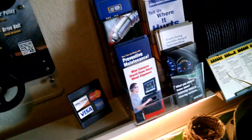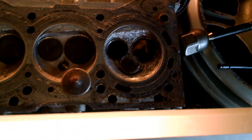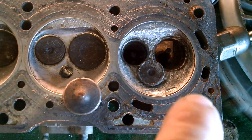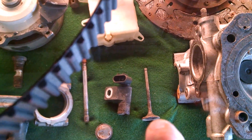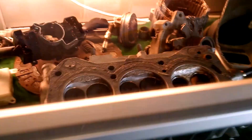What can happen if this does break — here's an example from an old three-cylinder where it actually did break a timing belt a number of years ago. It sits in our display here — we call it our display of shame — where parts have failed just because of maintenance in most cases. You see those pieces laying there: those are the heads of the valves that used to sit on stems. When they came in contact with the piston, the piston exploded, bending the rod and breaking the valves off. That's a valve there, and the stem is completely broke off when they all hit. It was a catastrophic failure. That's actually the timing belt behind the case there — you can see it has broken teeth, and down at the end there are no more teeth. It's all stripped out, and this belt actually ripped in half.